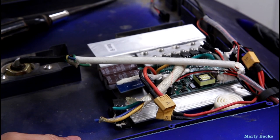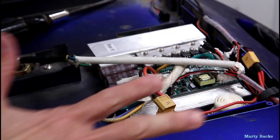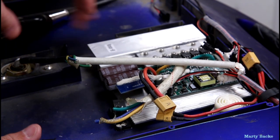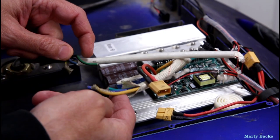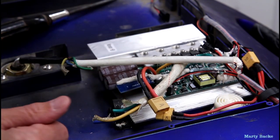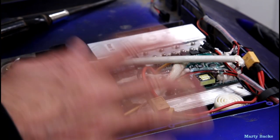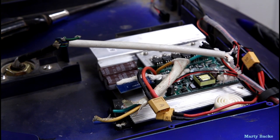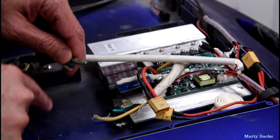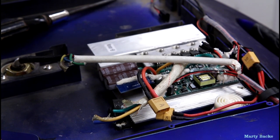This is another day. This whole operation is going to go for quite a few days probably as I get time to work on it. I've taken the control board side apart, batteries out, and I just wanted to highlight that I've cut the motor wires. I decided I wanted to get rid of the connectors — these are the oldest style connectors, my Monster is one of the very earliest ones. When I put it back together, I'm just going to be soldering new wires in between, and that'll make me feel better than riding with connectors.